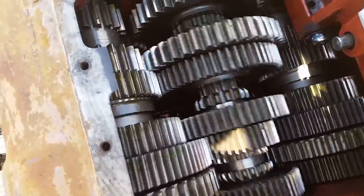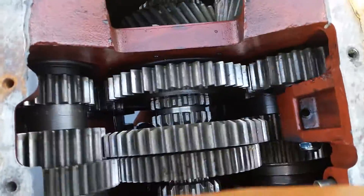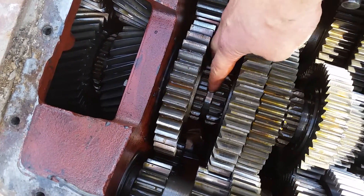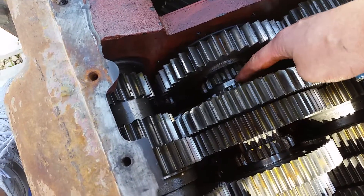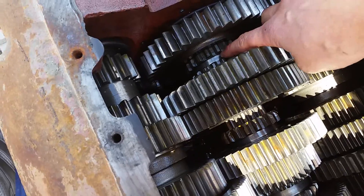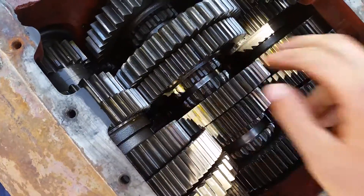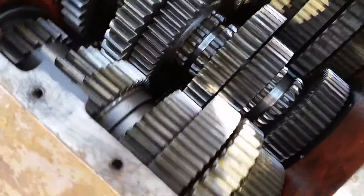This is how the gears work inside of an Eaton Fuller 13-speed transmission. So if it doesn't go into gear and your RPMs aren't right, you will be forcing the shift fork to force the gear into synchronization, which will grind the teeth against one another. Because at all times the transmission is spinning, if the gears don't match at the time they are switched, it will grind. This is why double clutching is most important.